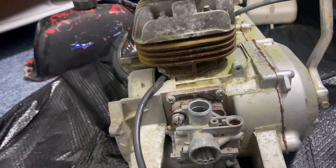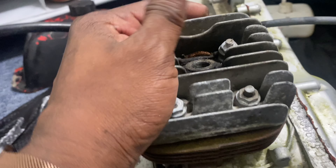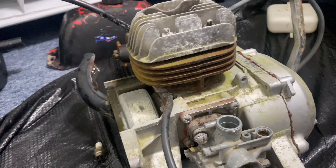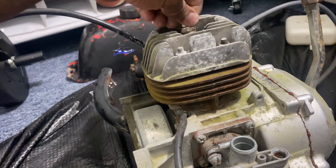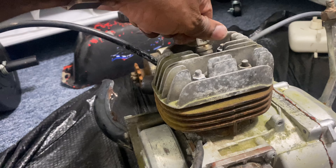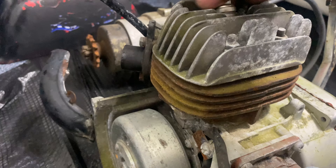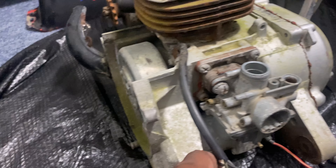I really don't want to take this cylinder here at all, but I don't know how that looks inside right there. I definitely have to get a flashlight or something to let y'all see. It looks grungy from the outside — you can see it right there. The spark plug was in it, so I don't know if moisture got in it or not. It wasn't seized up in there — it screwed out good. And it screws back in good, so the thread is good on that. We'll still clean all that up. Like I said, I'm going to pressure wash the whole thing.